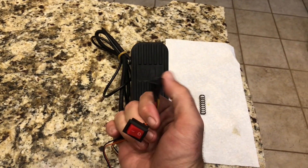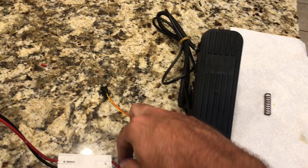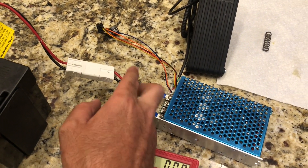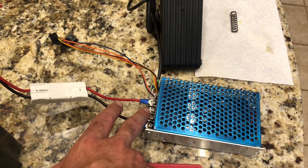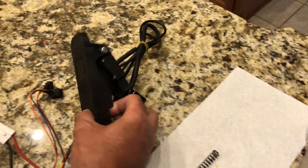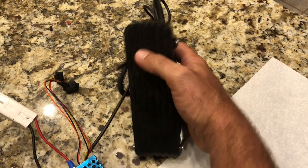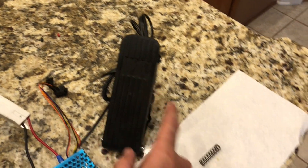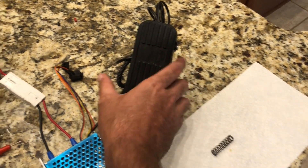You also have your on/off and your reversing switch. I cut this wire off my burned up speed controller and mounted it here. Your two inner wires here are for your motors for the gas pedal. It has a sliding mechanism with two springs, and for a child this would be very stiff — it's definitely meant for an adult. Luckily you can take one of the springs out.